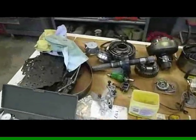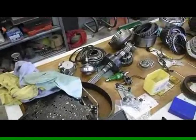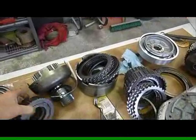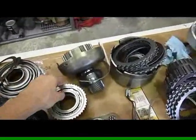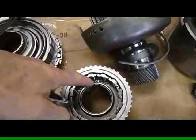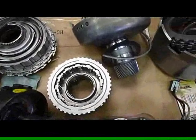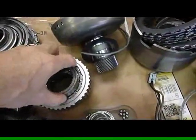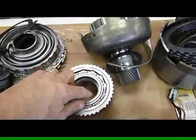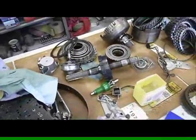There are a few things I've learned since putting together the one in my Vista Cruiser, which has subsequently been modified. A weak spot in these transmissions that you have to be very careful with is the low sprag. Some of the older ones have a fiber washer that sits in the back that can give a lot of problems — that's what happened on my Vista Cruiser. It caused this inner race to shatter, but fortunately it was caught in time just as we were leaving for a car show, and it's since been repaired.